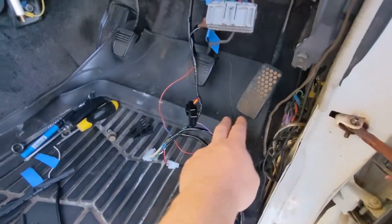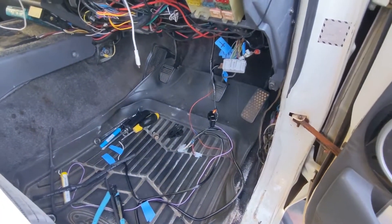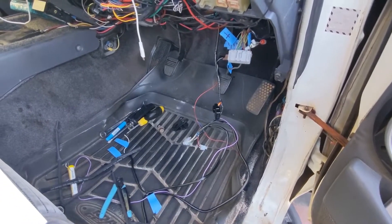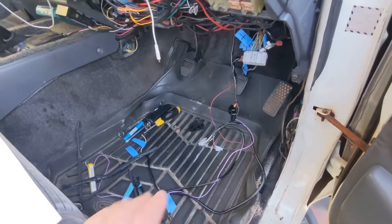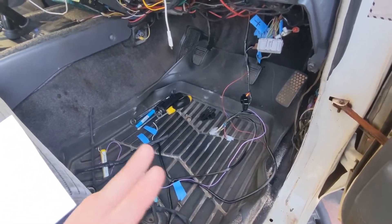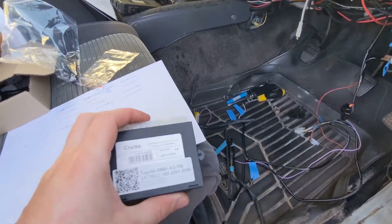I do have a video on setting that up in my other videos if you want to check that out. However, the cable setup wasn't too great because it's a drive-by-wire pedal being pulled with a cable mechanical unit — the polling rate wasn't quite good and it used to lurch back and forward and hesitate when it got to speed. So it was pretty rubbish, so I contacted AutoStrata.